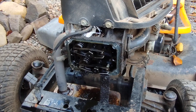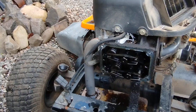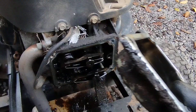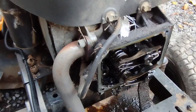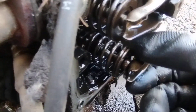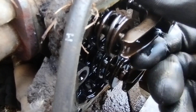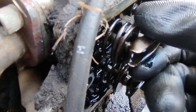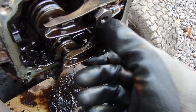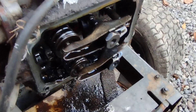I thought, how can it run if it's got a hole in the valve or the valve's not shutting all the way — how are we getting compression? So I just popped the valve cover off real quick, started playing around with the rockers, and I looked and thought — that bottom one's got a cap on there, like a shim in a bucket like on a Japanese motorcycle. But that top rocker is awfully loose; this one's pretty tight but I could still move it, so I rolled it over.